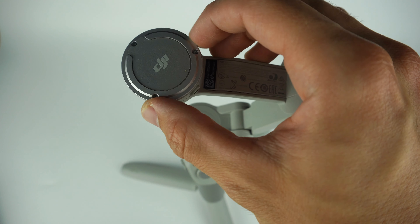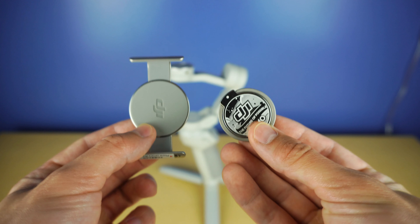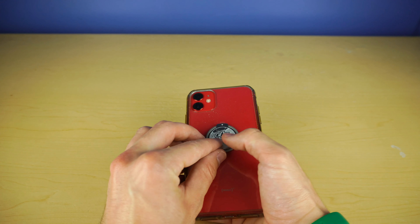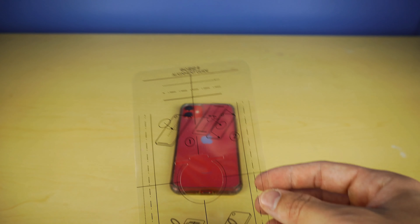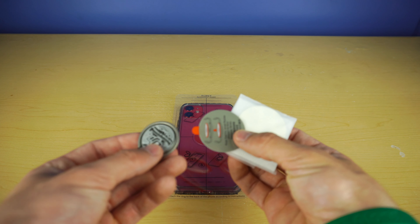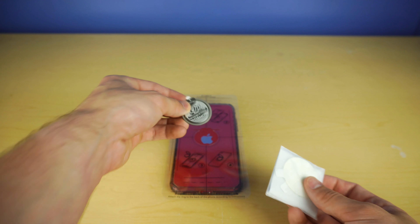At the top, I am fired up about that new magnetic setup. Instead of having to clamp on your phone or screw it in like previous versions, you get a magnetic clamp to clamp on your phone or a magnetic ring holder to stick to the back of your phone. Do not take that magnetic ring holder and stick it to the back of a phone case only, because it's not meant for this — over a short amount of time they say it can start to peel and potentially fall off. Only stick this bare to the back of your phone. They give you a plastic piece that lines everything up and lets you precisely fit it in the middle of your phone, and there are directions — make sure you follow them. You have to put down this first padding, then the sticky magnet on top of it, and then let it sit for so many hours.